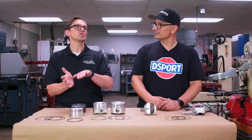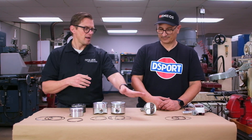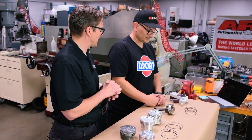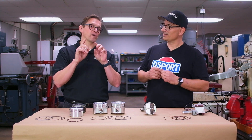That's what's best for that application. Typically your super high boost and nitrous tend to come to the same place — steel, PVD, that's what you want. Having gas ports in there to get it to seal up is important because you don't want the nitrous in the crankcase. You want to keep it up top so you don't get flame paths down the piston — a sawzall in your piston is never a good thing.